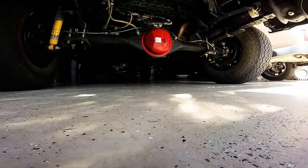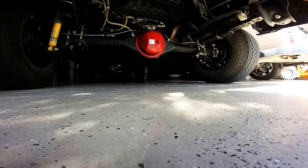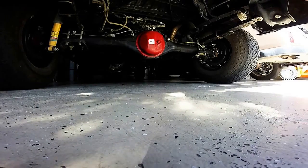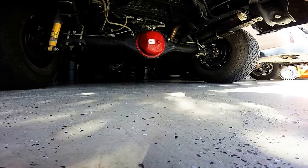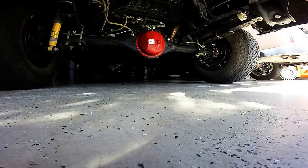Okay guys, I'm now parked on level ground at my parents' driveway. I actually just drove over here, which I'd recommend — if you drive your car for a little while before you attempt this, it heats up the oil and makes it flow out a lot faster when you drain it. You don't have to, but once you have the drain and fill plugs open it'll come out much quicker.